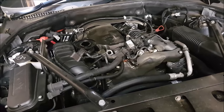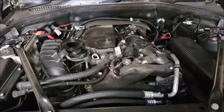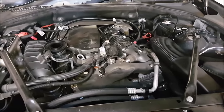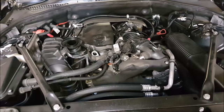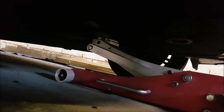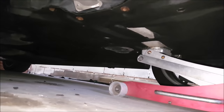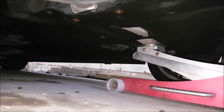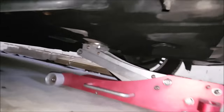Now I'm going to actually jack the car up. The jacking points are in the center under the engine - it's got the crossbar and everything like that. Once the car's jacked up in the air I can look at loosening the drain plug. Just there - that silver part - that's the jacking point under the engine bay. The reason why you need to use this is because that gray part there, that's where the sump plug is. So in order to get the jacking mounts under the area safely you need to jack it up from here.